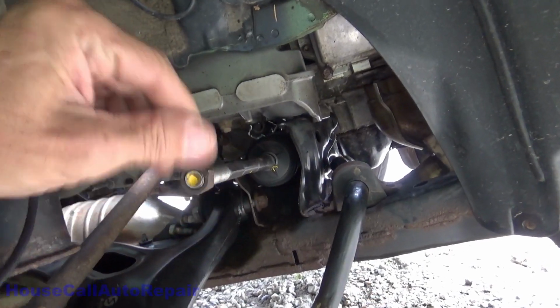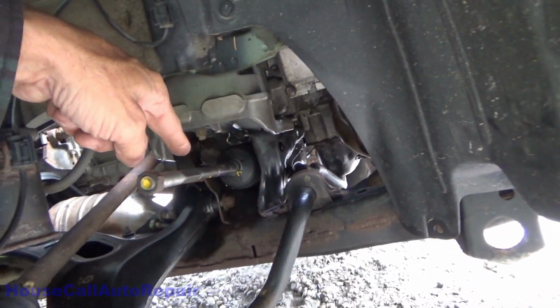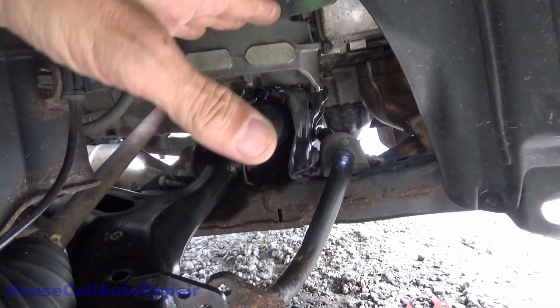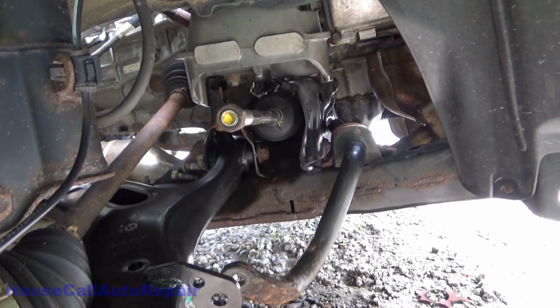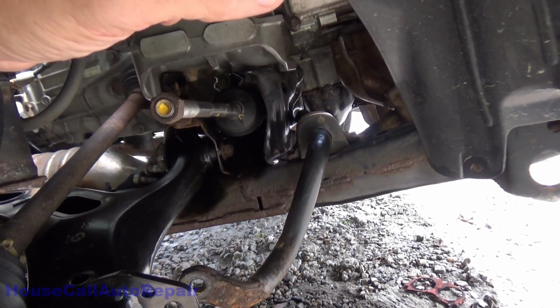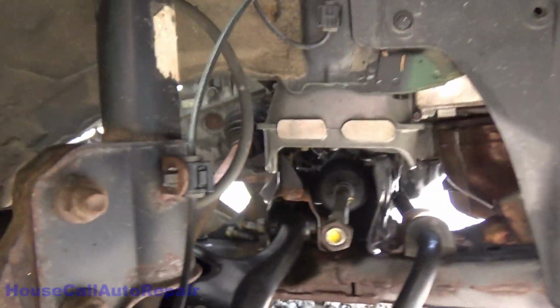We've got our nuts on the ends of the steering rack. The steering rack is all bolted down into the subframe prior to putting the subframe back in the car. That's the important part, that the subframe and the rack is a single unit out of the car, reassembled first. The entire order of operation was all wrong with this disassembly.